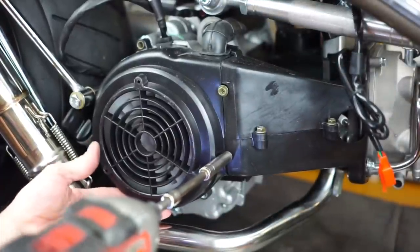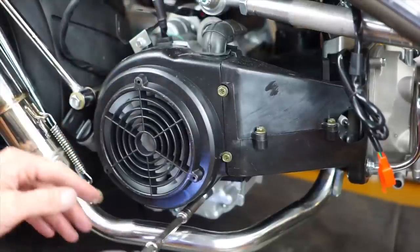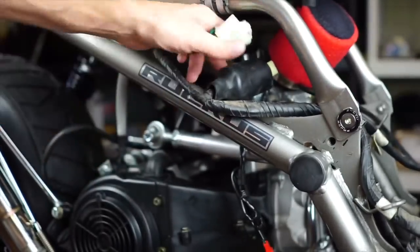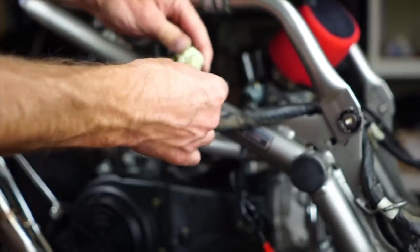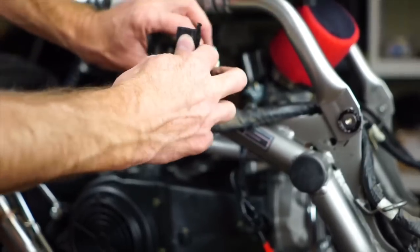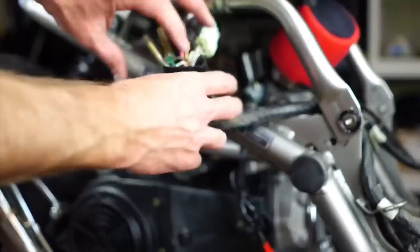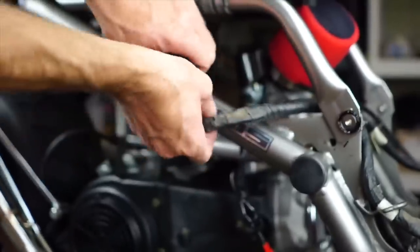The screws going in here are just plastic, so don't overtighten. Now that your stator is installed, run your wires over the top — however you want to route them. Here are your OEM connectors; there are only two options, just like blocks when you're a kid — find the match and plug it in. There are going to be some wires you're not using; just put the little cover right over them like it was stock.